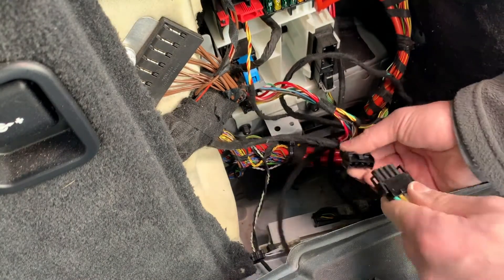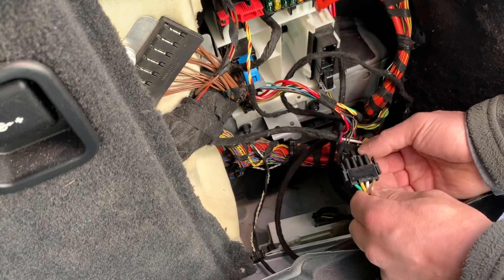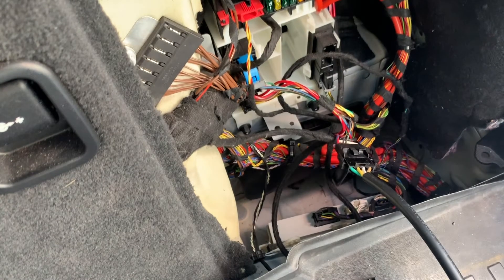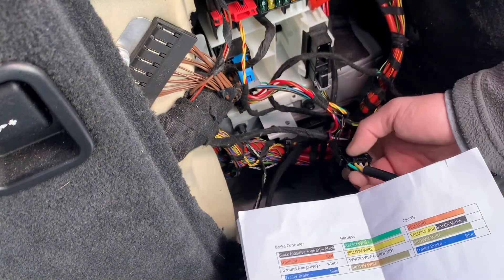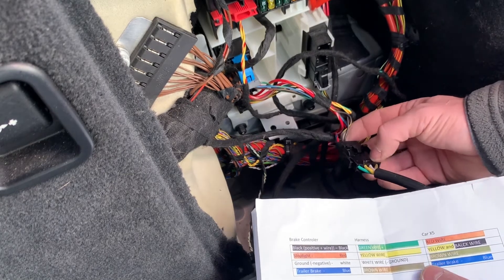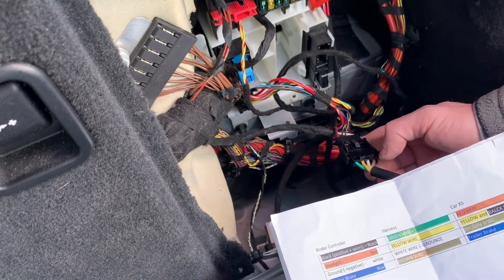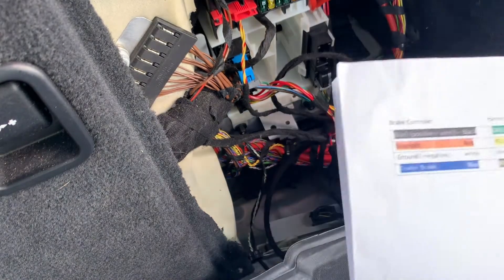You now have a brand new plug — it didn't take much effort, you just had to plan it out. Let's connect our harness and see if it checks out. These Molex connectors are keyed so you cannot plug them in the wrong way — there's no way to mistake it if the wiring is done correctly. Wiring check: car red (power) goes to harness green — correct. Stop lights (yellow-black on car) go to yellow on harness — checks out. Third pin: car brown (ground) goes to white on harness — checks out. Last: car blue (trailer brake) goes to harness brown — checks out.